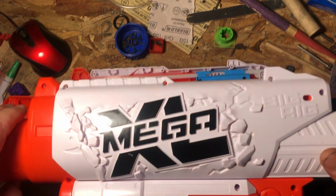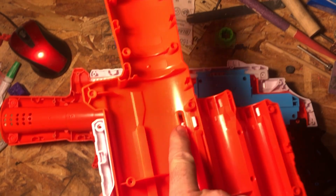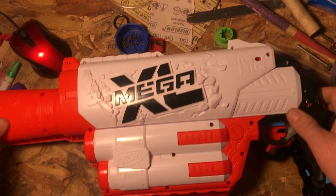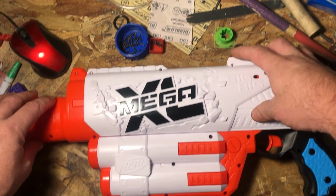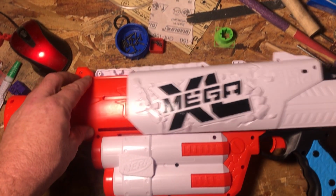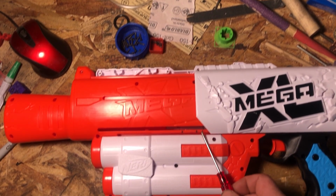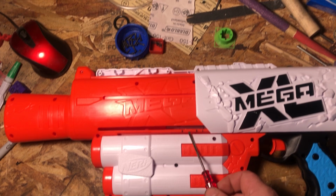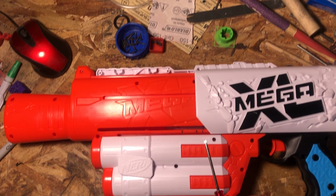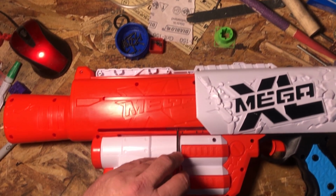The other thing you'll find is that on the shell, there's actually a screw here with a washer. Now, you can remove that. After you've unscrewed this and the shell's still together, you slide this back, lift up, and you'll see I made marks on the shell. Between here, here, and here, there's kind of a divot in the plastic.